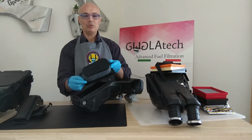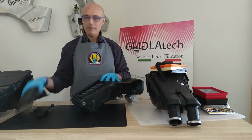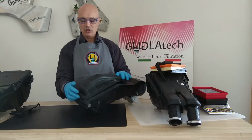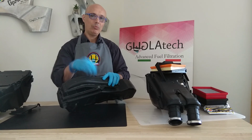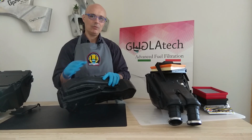It's simply beautiful. What happens is that, again, here we have a mounting, although KTM's design has two points of pressure. One is here, where the hinges are, and one is here, where you have the bolts. By the way, do not over-tighten or you will pull out the nut inside the plastic. This happened a lot of times, and there is already a fix on the web.